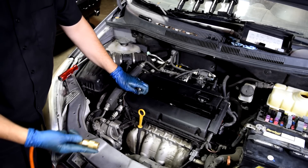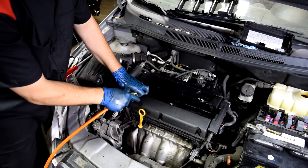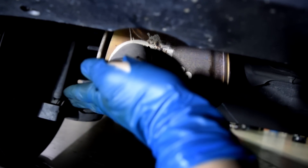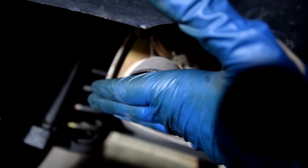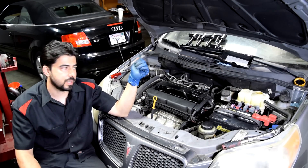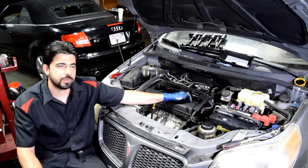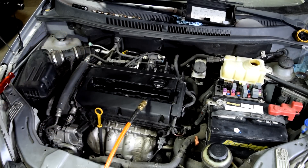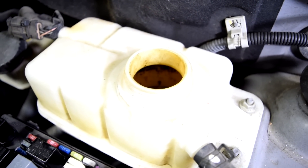40 psi is even too much for this engine so we're down to 25 psi. Then we check the exhaust — if you feel air coming out of this, that cylinder is on the top dead center exhaust stroke. I bet you guys can hear that — so this cylinder is at top dead center exhaust. That means cylinder number four, its sister cylinder, is at top dead center compression stroke. We attach our air hose — and there you have it. Undeniable leak into the cooling system.